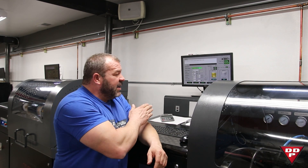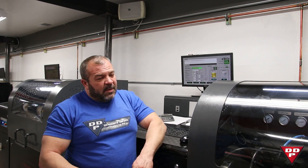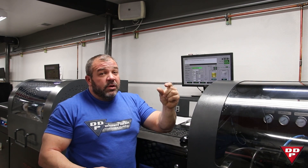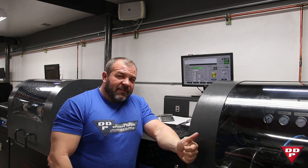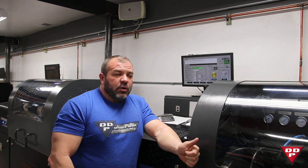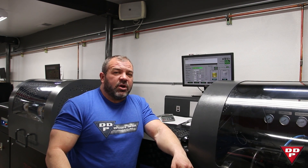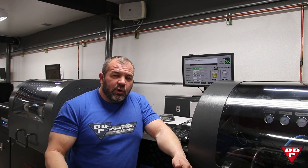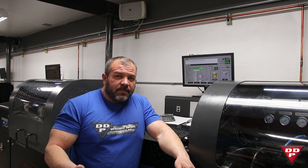Now I could ask this injector to stay open for more injector on time, but that 3.5 number is going to diminish because as the piston goes up, you're optimizing compression. The faster you can make the explosion happen at the top to force it down, using all of its compression, the more energy you're actually going to retain. If we just leave the injector on time too long, we have to continue advancing timing and creating more cylinder pressure, which is hard on rods and head gaskets. And as you chase the piston down the hole, you're creating energy while losing compression — the opposite of what any diesel wants. When you buy a tune or a tuner, be sure you ask them to limit your big tune to 2400 microseconds if you're driving a street truck. You'll be a lot happier.